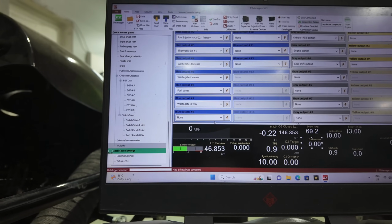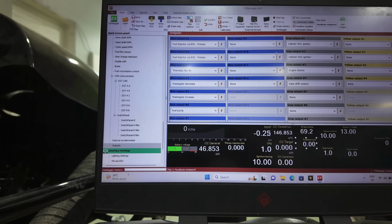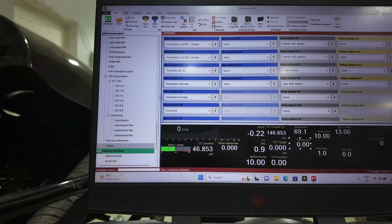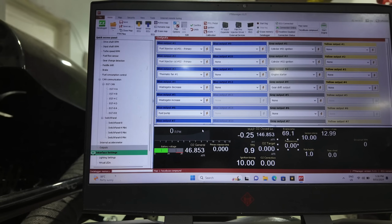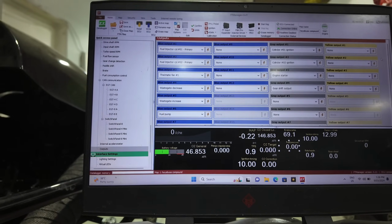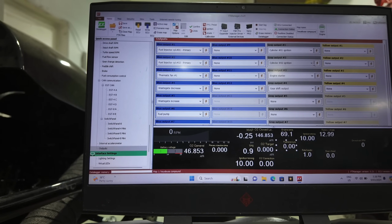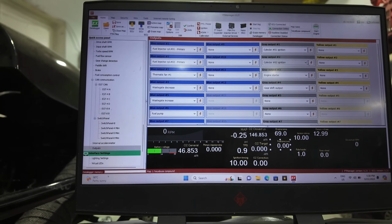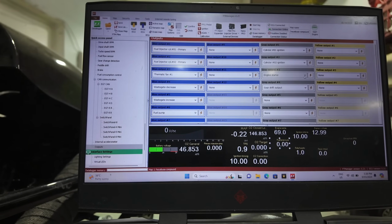Blue output number 8, I've got nothing. Blue output numbers 9, 10, 11 and 12, I've got nothing also. So I've got 5 blues left, so that's more outputs I've got. And for the greys, same thing. We've got it batched with ignition as well, cylinder 1 and cylinder 2. That's batched, and then we've got engine starter and gear shift output, and that is it.